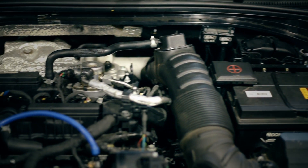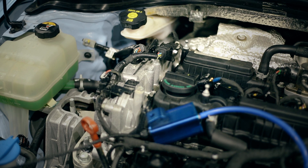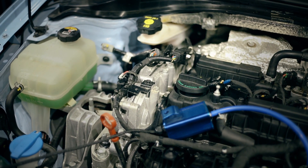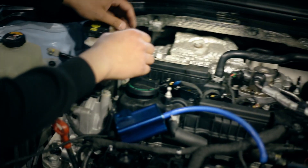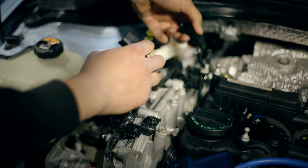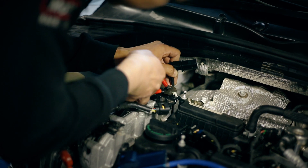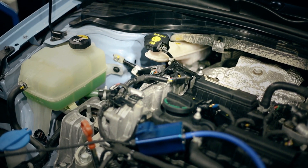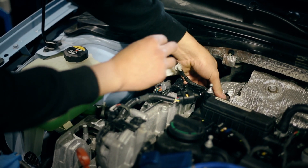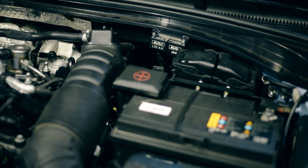Now that we've completed everything on the passenger side of the vehicle, we'll move over to the driver's side and replace the factory O2 sensor with the supplied Bosch LSU 4.9 sensor. In order to do this you'll need a 22mm open-ended spanner. We'll remove the factory ECU connector from its bracket, push the clip in and remove the sensor wiring mount from the rocker cover as well. We'll then reinstall the Bosch LSU 4.9 sensor into the factory location using the factory installed bung in the dump pipe, then route its wiring over to the MoTeC LTC mounted on the firewall.